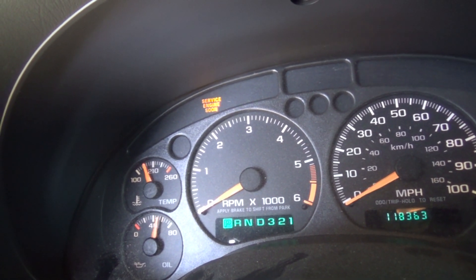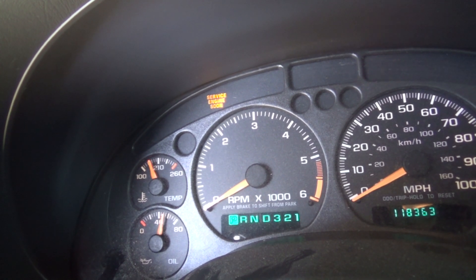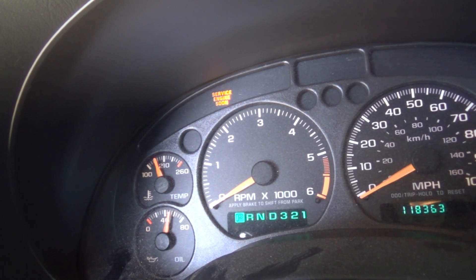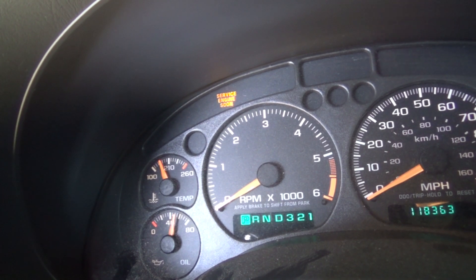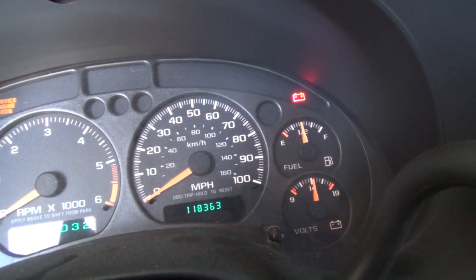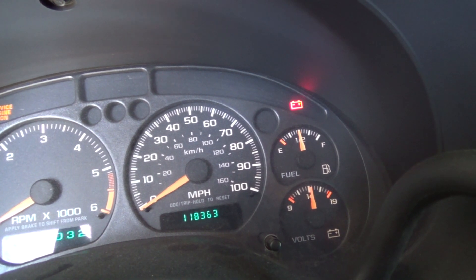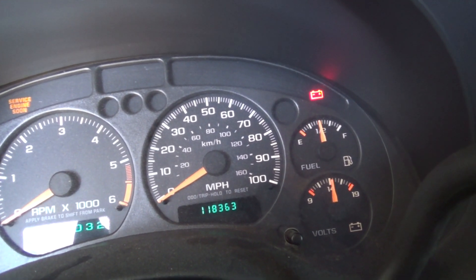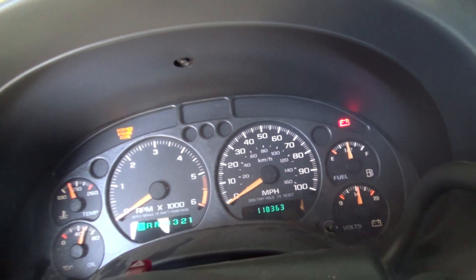The wiring I have going to the tach port on the coil is not doing its job — either the wires aren't hooked up properly, I chose the wrong wires, or I have a bad connection somehow, which I can't imagine because all the joints are soldered. I also have a battery light on and the charging gauge is not functioning — it's up at 14 and just staying there. So I've got a wiring issue to check into, but she's running as you can hear.